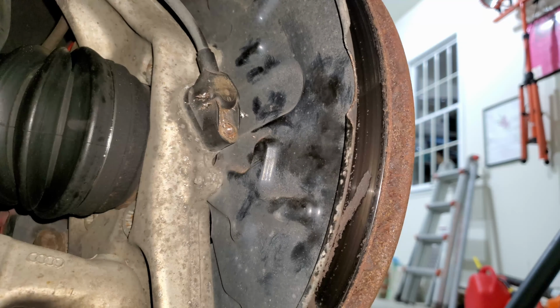The more drastic measure I'm referring to at this moment is I'm going to drill a hole, if I can, into the sensor, and then I'm gonna drive this big giant screw in there, and see if I can use the screw to get some leverage on it to pull it out. I don't know if it'll work. Probably just pull the screw right out of the hole that I drill. Worst case scenario, I'll just put a really giant drill bit on it and drill the sucker out. Or even worse, I'll disassemble the entire hub, at 1 o'clock in the morning on a Sunday night, and try to get it out that way. That's the worst case scenario. Let's see how this goes.